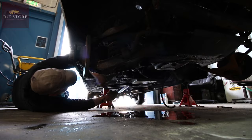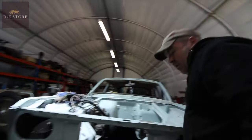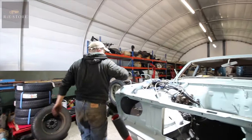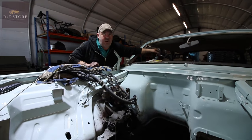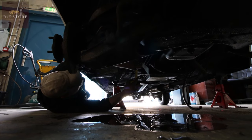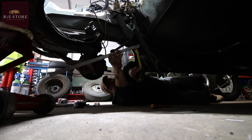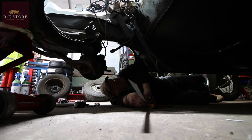I'd say that's 150 but that looks like a longer drop on that. It might be the same - best to check though. Would that affect the steering if it's out? Yeah. We've got about a 10mm drop off the base of the nut, that's got about 8mm. I don't think 2mm on that's going to make the slightest bit of difference.